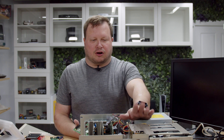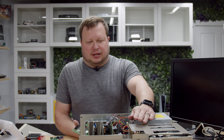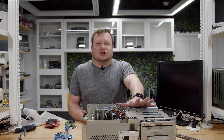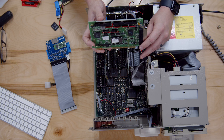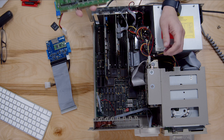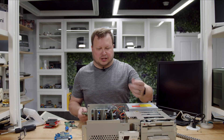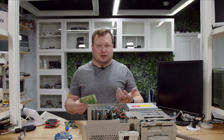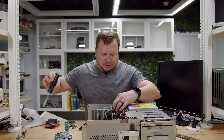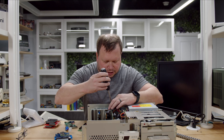Unfortunately the hard drive method didn't work — or rather, there's simply nothing on the hard drive. Let's go ahead and try method number two, which is the SCSI card. This is an AHA 1522A. We're going to try using it as a replacement for the floppy controller as well, so we'll pull that out, put this in, and see where we're at.